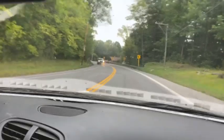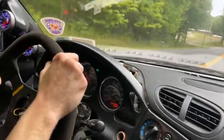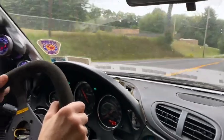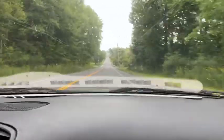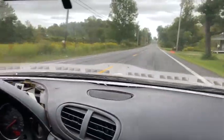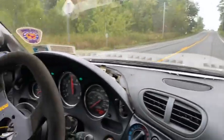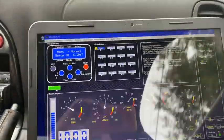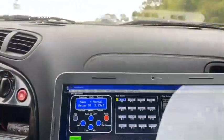This is an issue the old LT-16 Microsquirt had — the LT-10s used to have it too. I know they fixed it with the newer ones, but I'm going to try and shield it a little better, get it away from everything. We're going to try this and go out for a ride. It seems to be cruising a little better — that's much better. It was breaking up when we first went out. Just get on it a little bit to get an idea. Just a little bit of break up — you were too low on the RPM. Down shifting in. You were only at 4,500 when you downshifted.